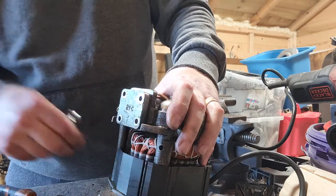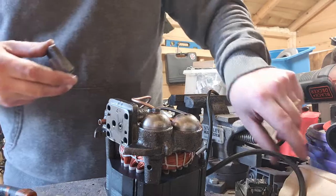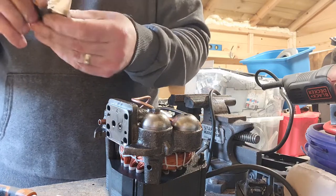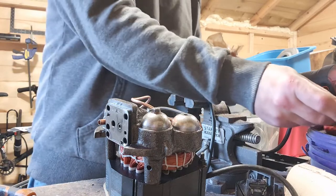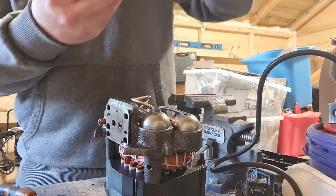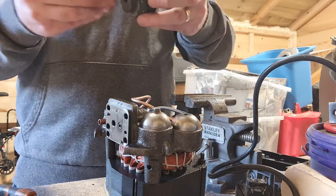Okay, I'm hoping that the outside of this motor here is all cast aluminium as well. So it looks like an aluminium piece, or aluminum for you American viewers. Tissue and dry this one off. This has got a little bit of oil in it. Should probably wear gloves doing this, then I wouldn't get such oily fingers, but it's fine. It's a little bit of cast aluminium there. Well, I thought it was aluminium, but actually, when I do the old magnet test, it's kind of semi-sticky. I don't know if it's just the end or whatever, but certainly not aluminium. Don't know if it's zinc, maybe. I'm not quite sure, but it sticks a little bit.